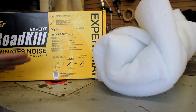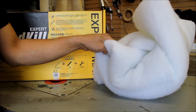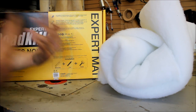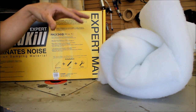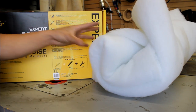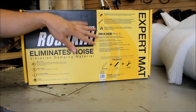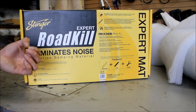Some other items to talk about quickly: polyfill and sound deadening. With polyfill you can load up the sealed enclosure quite a bit — if you're a little low on volume, it technically makes the box acoustically bigger because the air travels in different directions. This will increase effective volume up to just under 75% fill; after that it stops getting bigger. You can buy polyfill from your local install shop and experiment with it. For sound deadening, on the fiberglass sealed enclosure I'd put some on the inside bottom layer where you won't see it — this will help stiffen it up and remove resonance, since fiberglass is not nearly as stiff as MDF.